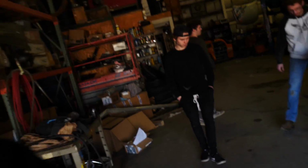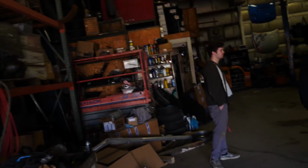Alright, truck's on the dyno. Pasha, you wanna go first with dyno predictions? Okay, my thoughts are. This 1UZ VVTi is out of an Aristo. Makes 300 horsepower crank and like 300 foot-pounds crank, I believe. We're gonna have a tune, headers, exhaust, intake. Mike's dyno reads similar to a Mustang dyno, so that's something to be considered. I'm guessing 288 horsepower, 292 pound-feet. I said 265 wheel.